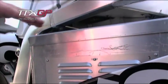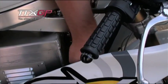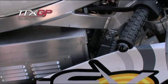On our bike we've got three separate battery modules — one in the centre of the bike, one in front of the motor, and one underneath. Total energy available is 7.4 kilowatt hours, which gives 25 miles of racing speed, or probably 100 or so miles on the road.